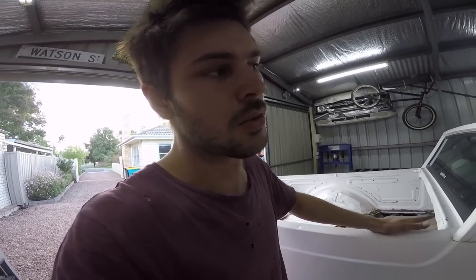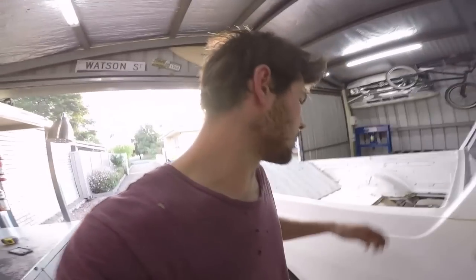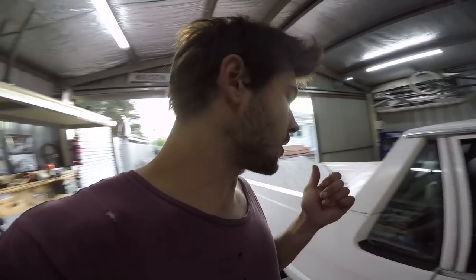To get the fuel gauge to work, it was a little bit tricky, or well, not tricky, but a little bit of stuffing around, because I've got the digital dash, which honestly probably made things easier. All I had to do was buy a module which converted the resistance to get the float gauge in the XJ tank to work with the signal for the XF dash. Now I installed this by myself the first time. The unit was $200. I installed it myself and I couldn't get it to work. I could get the float to get a position, and then the gauge would only get to 3/4 full when the tank was full, and it wouldn't work properly.